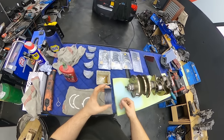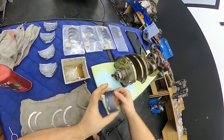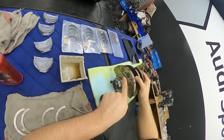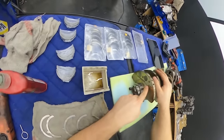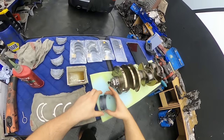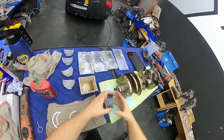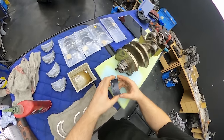Okay guys, these are the bearings for the crankshaft, and as you can tell, they're not genuine. These are aftermarket ones from the machine shop we're using. They are straight fit. An interesting thing on the crankshaft is this code here, all these digits, which says uniform, uniform, Bravo, Golf, uniform, X-ray. It is basically the thickness of each bearing on the conrod by a color. So under U it should probably be yellow, under B maybe red, I have to check in the manual. But since we're not using the genuine ones, it doesn't really matter that much, because the colors on the bearings mean the coating on the bearing, and we are talking about microns, so we don't have to do anything, we just have to put it back in.